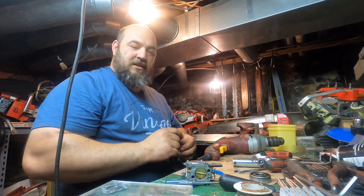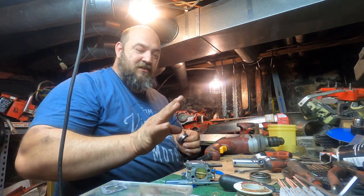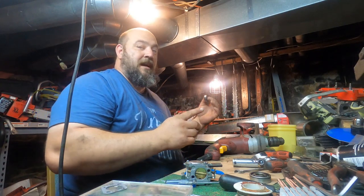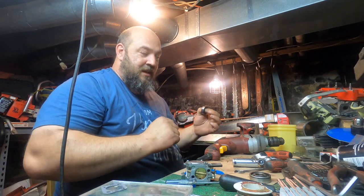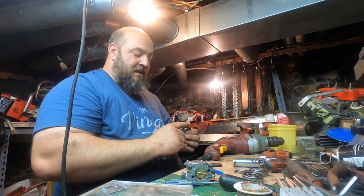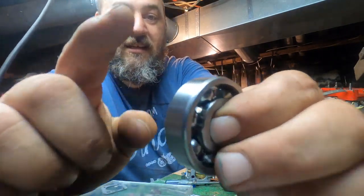Whenever you start having bearing failure, that's going to be basically the first stage of your failure. And really the only way to know is to have the bearing out and spin it and listen. That's the only way to really know. But then I want to show you a good bearing. Okay? So listen to this.